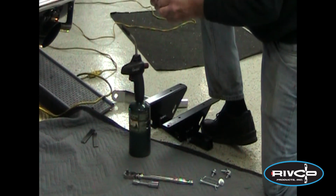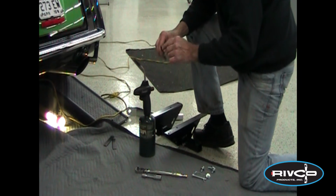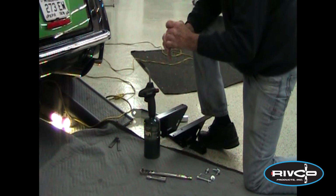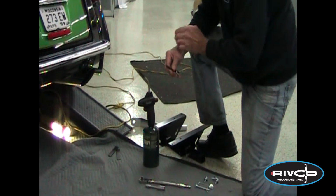And the other thing that's a little bit different is you'll need a T40 Torx or star wrench, a tamper-proof type. And tamper-proof means it'll have a little hole in the center of it, because the head of that screw has a little pin or stud sticking up from it to keep you from trying to take it out. But it's called a tamper-proof.